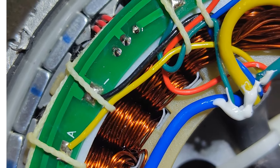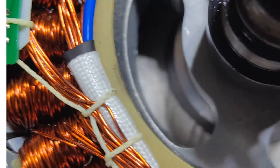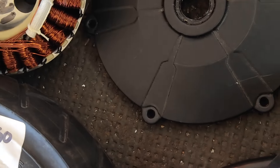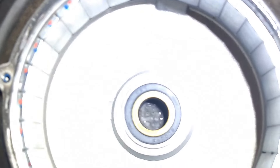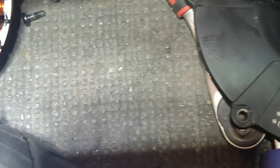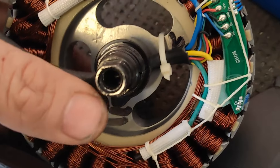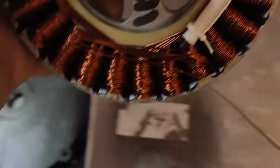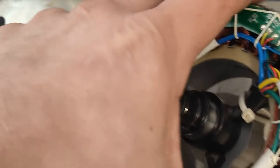Next we're going to have a little look inside — I've opened them all up and released the cases. The sensor board is an SD-115; you'll see that the white cable for the temp sensor isn't connected on any of the Pure wheels. Same again — SD-115, identical inside — that's the 350 watt, looks very, very similar. And here's the 500 watt, which has a different board for the Hall sensors, different setup, but still no white cable connected.